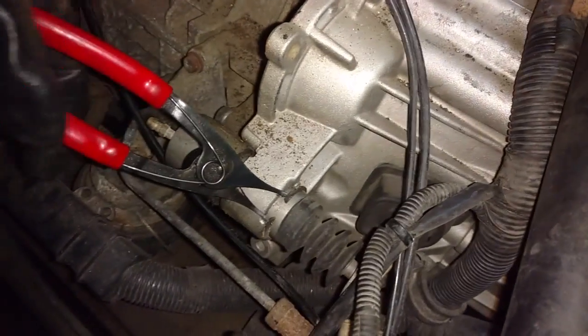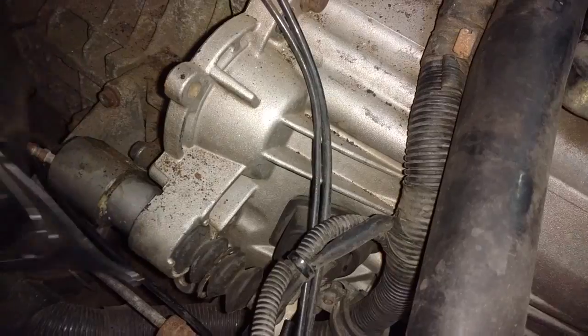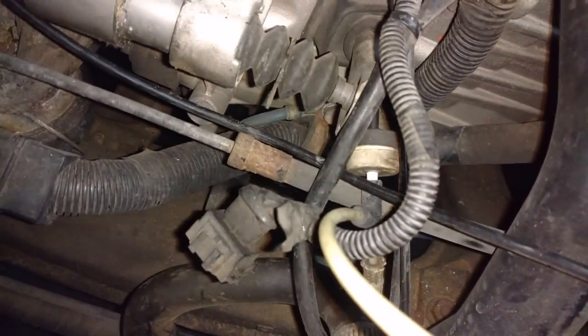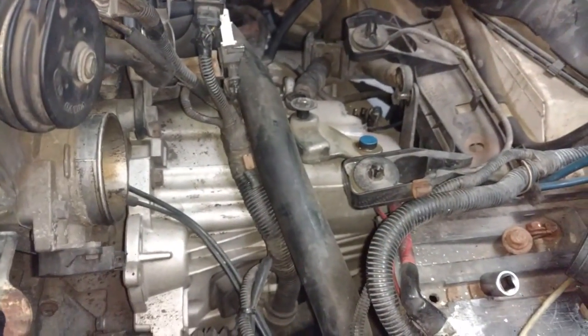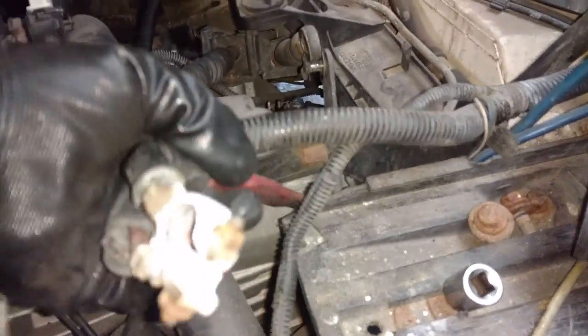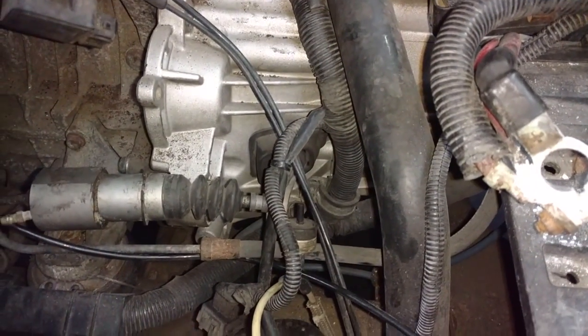As you can see, it's already coming out, and it was pushing on that linkage there. Let me pull that out and take this bracket and line out of here. Put the clip ring back so I wouldn't lose it, and when I unplug that back there, I'm going to lose some fluid. So I'm going to get this stuff out of the way so I can lift all this out. And I also am going to drain the coolant.